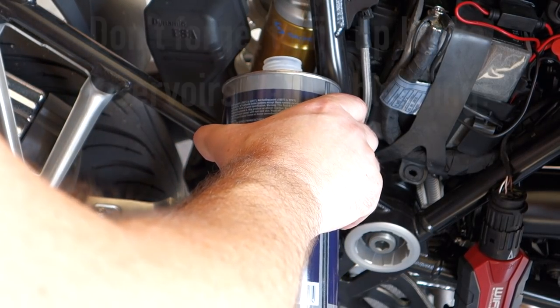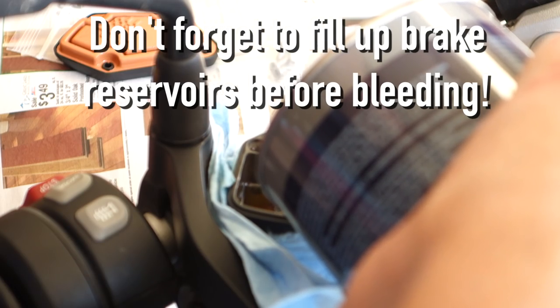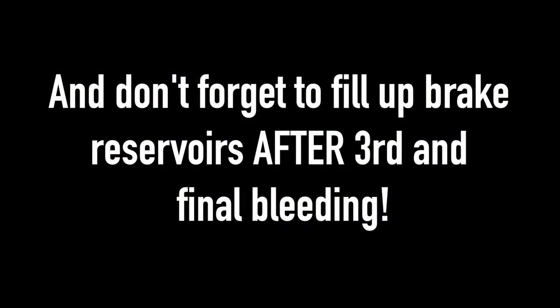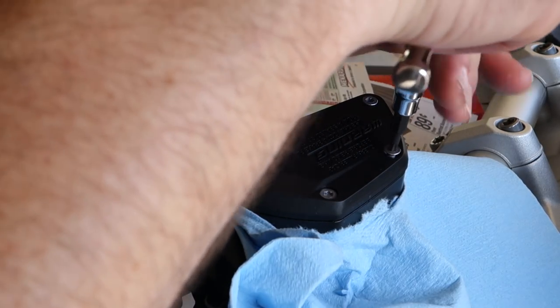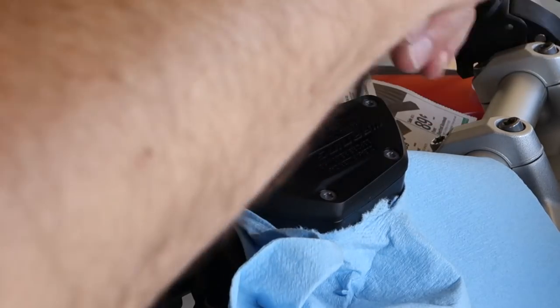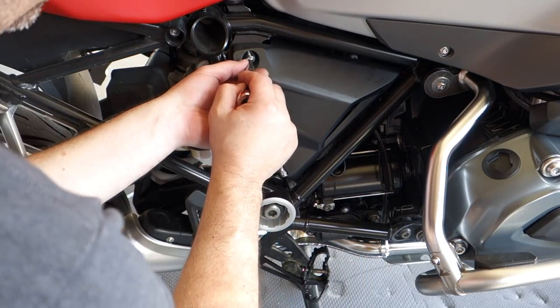Now repeat the mechanical bleeding process for the third and final time. Once you're finished with the third and final brake bleeding, you're all set. Go ahead and close up the brake reservoirs and don't forget to put those rubber caps back onto the bleeder valves. I also wanted to mention that the ABS flushing process does not pump brake fluid from the ABS unit back into the reservoir — as I suspected, it basically just bleeds the air from the ABS unit. Thanks for watching, I hope you enjoyed this video and please subscribe to my channel.